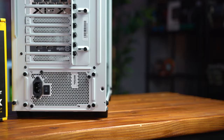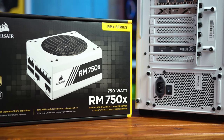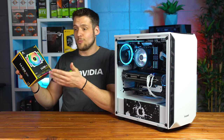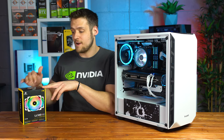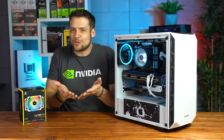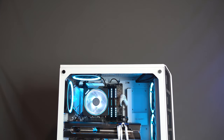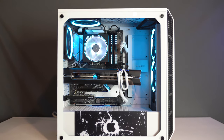Rounding out the parts list we have the power supply — the Corsair RM750X. It's rocking an all white design with white cables so I didn't need custom ones, it's fully modular, and 80 Plus Gold certified. For RGB fans, I went with the Corsair LL120s, but unfortunately you can only control the colors through iCUE software and there's no physical button. The Corsair iCUE software for macOS can only control peripherals, so I swapped them out for the Antec RGB fan kit. Be sure to use RGB fans with a physical button because you may not have the software support to change colors on a Hackintosh.